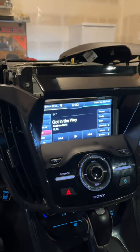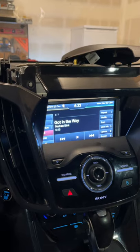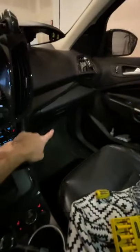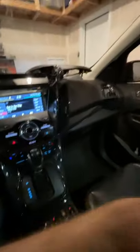This is a 2014 Ford Escape. One day the audio stopped working — there was no sound coming from the speakers. I looked up a couple of YouTube videos for some ideas and checked the fuses associated with the audio system under the glove box and in the back. They all looked fine.